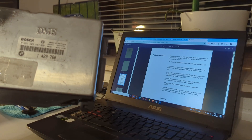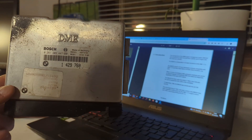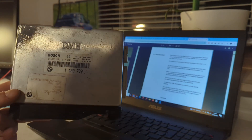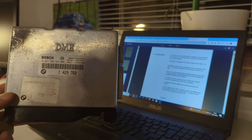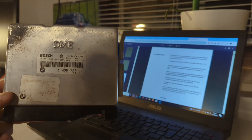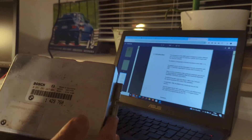No real DIY tuning method - until recently, someone or the company publishing MS41 QuickFlash also published a flash tool for BMS43, which is very good. And now we can start looking into messing with this ECU. In parallel, someone has developed from scratch an XDF definition file for Tuner Pro with the basic maps - ignition, fuel, etc. So you can do basic tuning on it, and it's a good time to look at it.